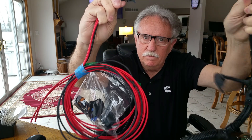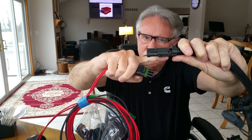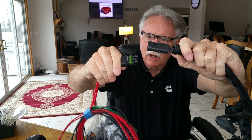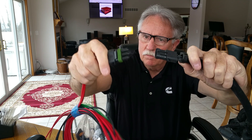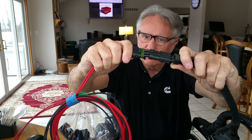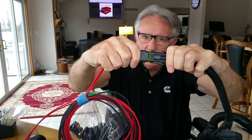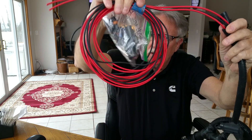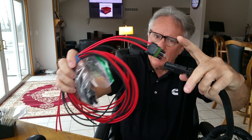If this connector hasn't been cut off — which happens on 15 to 20-year-old trucks where someone ran wires direct to the battery and cobbled it up — this is basically a universal OEM connector to do the job right. It has weather pack seals and it's made for this connector, so you just shove it in and connect it up.